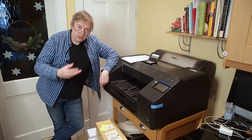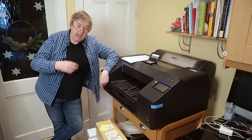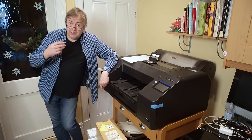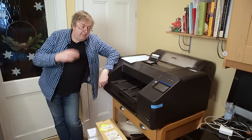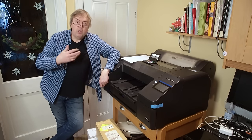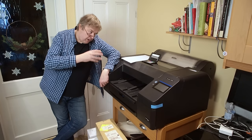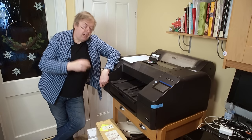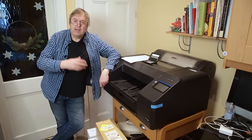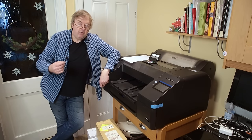In general, the bigger and more expensive the printer, the more care you actually need in using it regularly. The P5000 was designed for commercial print use — running the printer every day, all day long. It's got all sorts of design features to minimise the build-up of dust, paper dust, ink vapour, and ink droplets collecting inside and causing problems. But it was not designed to be left for weeks on end.